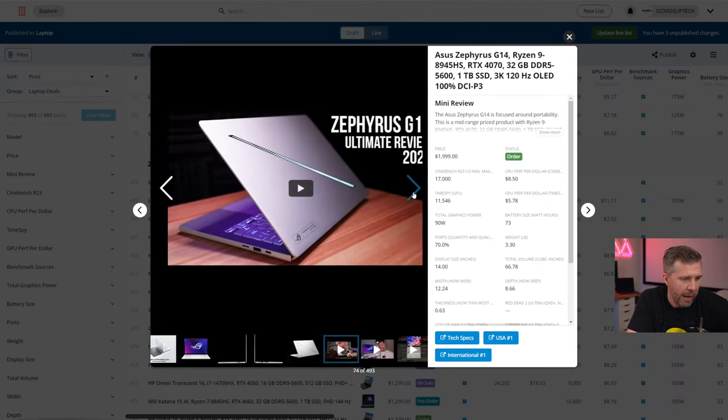And then we also have two NPU cores, I believe, on both of these systems, but they're basically super ultra high efficiency cores, not really used in the rendering of Cinebench R23 as much, mainly used for things like AI enhanced webcam background replacements and other AI tools inside of applications. So I haven't done a deep dive yet on those. So 17,286 for the Ryzen, 17,779 for the Intel Ultra 9. Let's get another run.